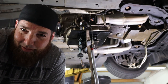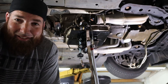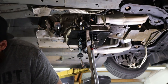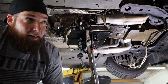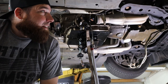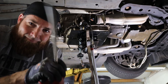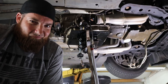All right y'all, so I got all the bolts off the bell housing. The one on the driver's side that's in the middle right above the alignment pins — that one's kind of a bitch to get to because there's not enough space. So you've got to use a wobble socket and kind of beat it on so it goes flat because there's no room. I knocked them loose with a basic wrench and then used the big half-inch gun on everything else on all the bottom bolts. I was able to reach everything pretty much with the half-inch except for those two above each pin on each side — it's just super tight and the socket doesn't fit in there. So I used the 3/8 wobble impact socket to get those broken loose and then zipped them off. Let's see if we can get this tranny out of the car without dropping it.